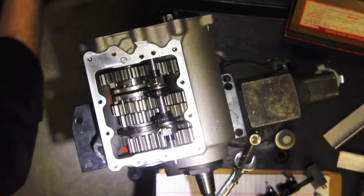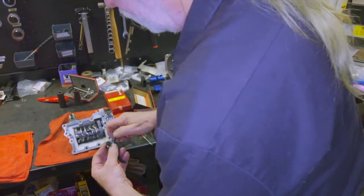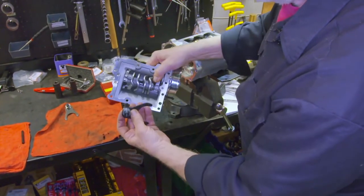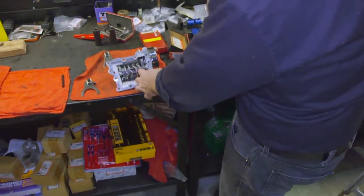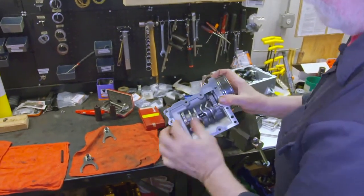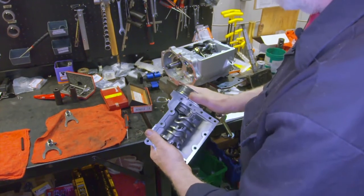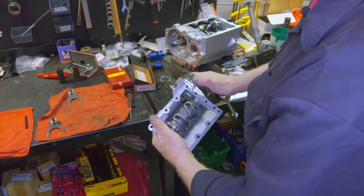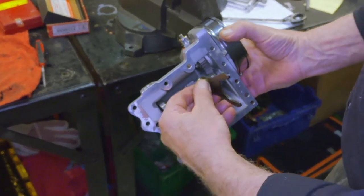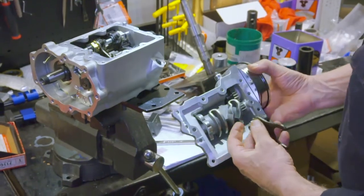So it is of the utmost importance that this is smooth on your fork arrangement and your dowel, that it must be extremely smooth, and as I said, will roll clean in each trough. Third and fourth gear are over in the cam slot on the right in my drum here. Again, when we've gone from first to second, it will momentarily neutralize to work our way to third and then to fourth, to high. This is with the narrower fork swinging its way over into high gear, over on your right here. So it's quite ingenious.